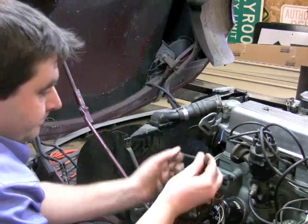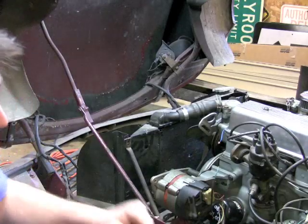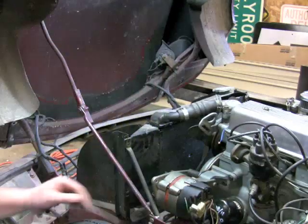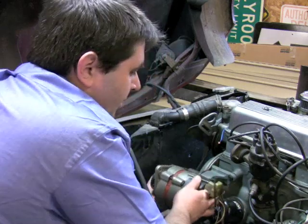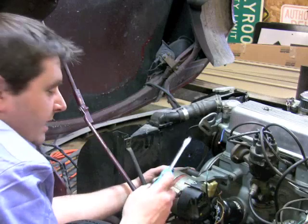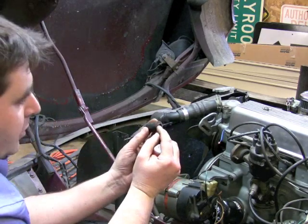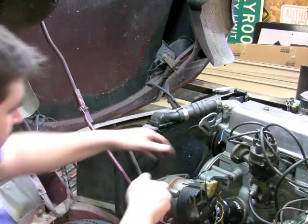Okay, the bolt goes that way. Now that we got that out, wiggle your plug loose right here on the back and take that off. The last thing is, if your alternator doesn't just slide right out, it's no big deal — there are a couple of collars in here that you may have to help wiggle loose. Get your flat head, get right up here toward the front, and you can wiggle that a little bit and that bushing will come right out. Then just pull your alternator off.